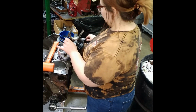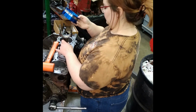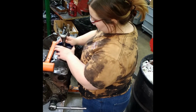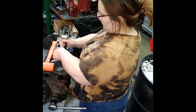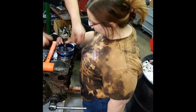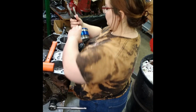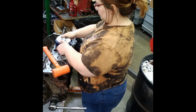Now you're cooking with gas. Right. You got it cocked. You need to pick it up. You got it. To get it on there, you got to kind of take your thumbs and press it straight down. There you go. And on that one side. There you go. Now, yeah, you can do that, but usually I like to stick a little skirt out so it goes in there. There you go. That is called the piston skirt.